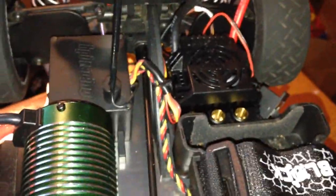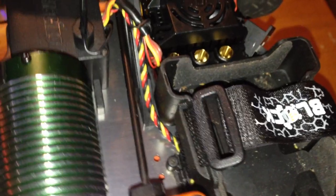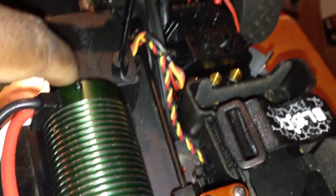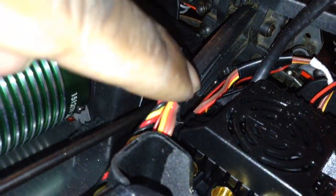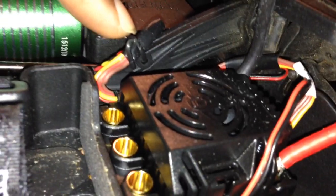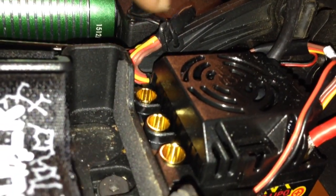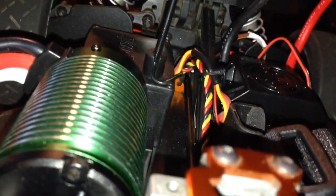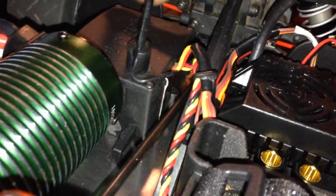I had to reroute the wires. Originally the wires came up under the drive shaft into the tray and into the receiver box. I had to put a hole inside the receiver box — a real tight hole. I put the wires through with a little tie, like a bread tie, on there. It's a real small hole already inside the frame — I didn't make it, it was already there — so I utilized it. Put the little tie on there to keep it in place so it won't hit the drive shaft. The drive shaft is clear; it looks low but it's clear. These wires are real thick, they're not budging, so they won't rub.